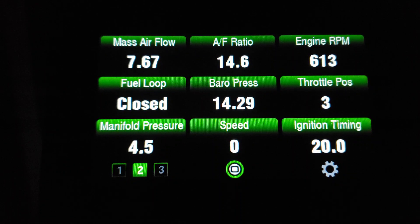In this video I'm going to show you how to test your mass air flow sensor. Our mass air flow sensor is critical to our workhorse chassis because it tells the computer how much air is entering the engine, so the computer knows how to calculate and deliver the correct fuel. It's a fairly common item to fail, and on almost any workhorse chassis once you get above 70,000 miles you should have already replaced your mass air flow sensor by now.